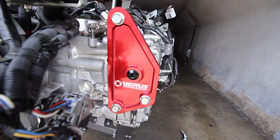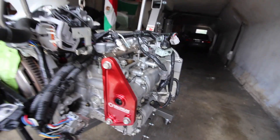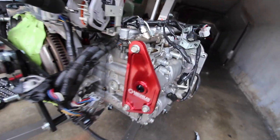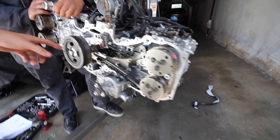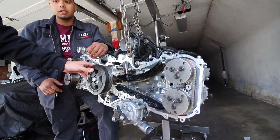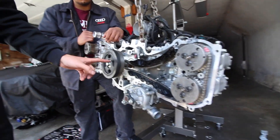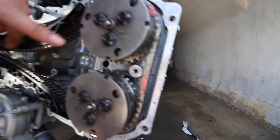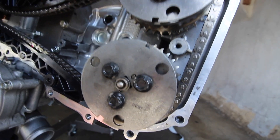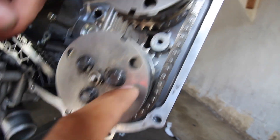As you can see we got a cam plate, so we can put the oil separator that we put in this car — we'll show that later. All we have to do is spin this crank. You gotta spin this one until these little markings on the arrow right here and right here face each other, and then that will set timing. Then it will be good to put it on.